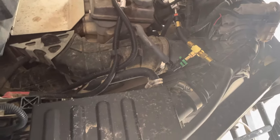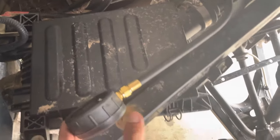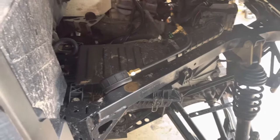I definitely have a fuel pump pressure issue. And when I would get on the gas and let off, it would backpop — that's a sign of running lean. I hope this helps anybody out. Subscribe and let me know if you have any questions in the comments and we'll see if we can help you out. Thank you.